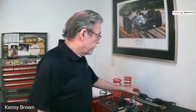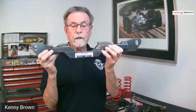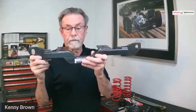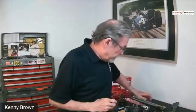But when it comes to stopping the wheel hop on the SN95s, we've got a really simple starting point. The first starting point is the forward torque brace. Turn it around, Ken. This replaces the factory one. It's kind of a hollow bar loop that actually does deflect. This doesn't deflect. This is rock solid. And then on top of that, we put our aluminum